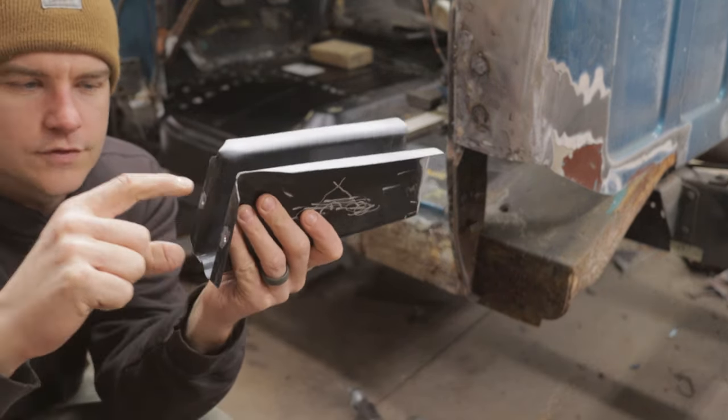One of the major benefits of replacing this floor panel — and why I'm going to do it on the other side too — is I wanted to see the structural health of this cab support in the rear. With a hammer, everything felt very solid back here. The surface rust looks good and once everything is welded up we're going to spray Eastwood internal frame coating in there and it will last a very long time. We do the same thing with this rear floor section — set it up and use a sharp awl to scribe the edges for a nice perfect-fitting panel. These little butt weld clamps are probably the greatest invention in a long time — they clamp a nice tight edge for a good butt weld and leave a little bit of gap so you get plenty of weld penetration and a nice strong joint.